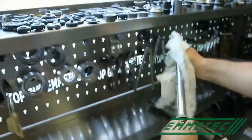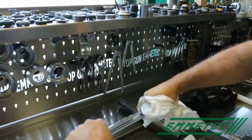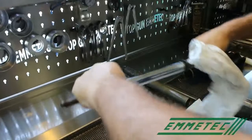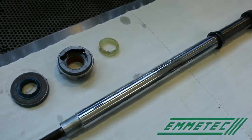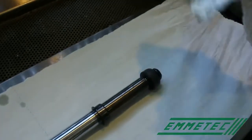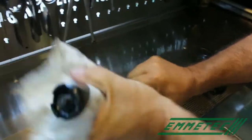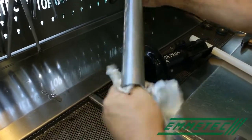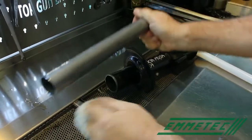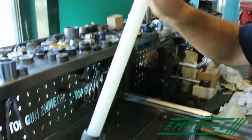Clean the rod and remove the stop rebound. When cleaning, you have to use paper, tissue, and compressed air. Because we are filming a video, we couldn't use compressed air — sorry. Clean the inner cylinder inside and outside. With a teflon bar, not metallic, remove the bottom valve.